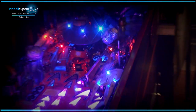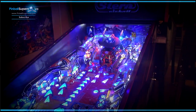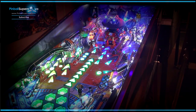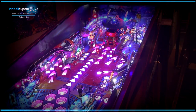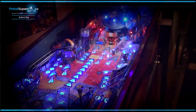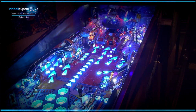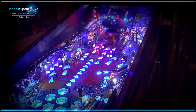I'm going to zoom out here to take a look at the whole playfield. Basically, if you think you're going to remember where the screws go, you're probably not going to. So take pictures or organize them. I have a magnetic jar lid that I put all my screws on and keep them organized so I know where they go back into the machine. I'd highly recommend that method, because this mod — you definitely are going to need it. You have to take apart a lot of stuff to get to those pop bumpers.